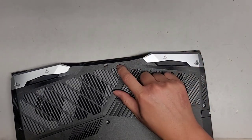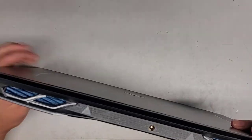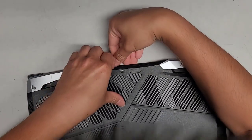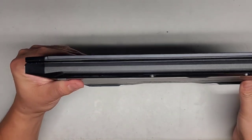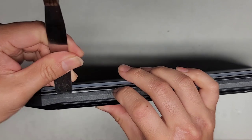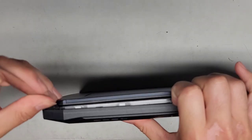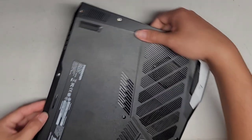Is there a hidden screw under here? It says 'caution' and there's a thing there — I don't know if that's a hidden screw. It might just be an injection mold thing they're using to cover. So far no luck. I guess let's try with the metal tool. I'm going to get the tool in here and try to pop the front a little bit, working my way down the side edge — and I can see it's popping out. Because it's so thin, using fingernails or plastic tools is probably going to be very difficult.